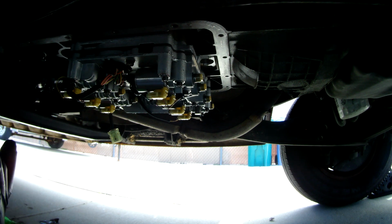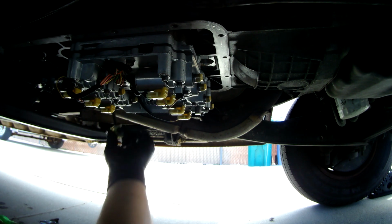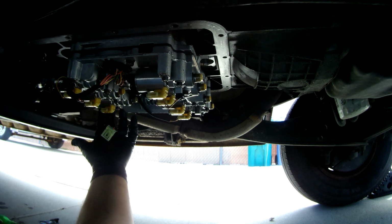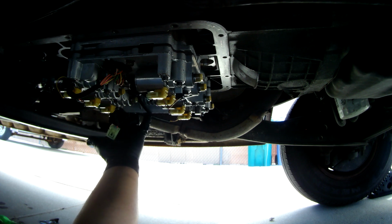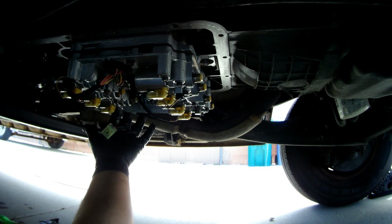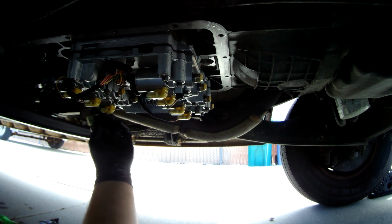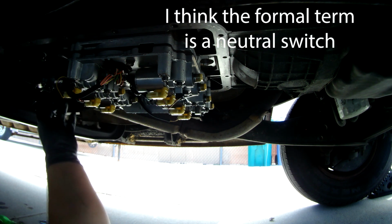I could do one other thing, and that is connect the power, which is right here, to the connector that's right here that goes up in the transmission. It's part of what we have here for the manual control. So your Prindle moves this sprocket here, and it just clicks over this, so you know you're positively in each spot. It moves this valve back and forth, but it needs to know what's going on with it, and so we need to tell it. And there we go. So power's connected up in here.